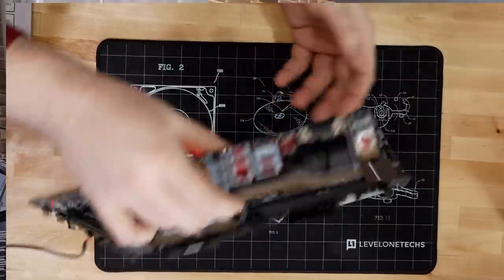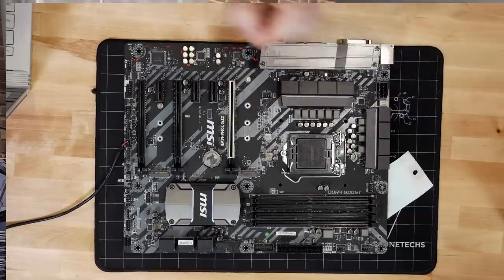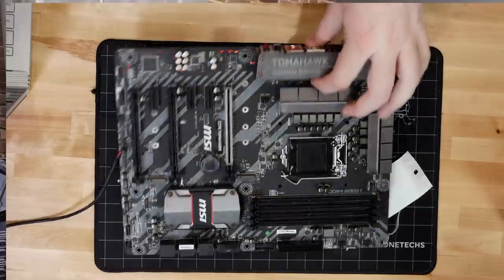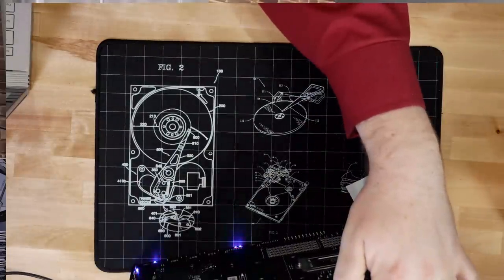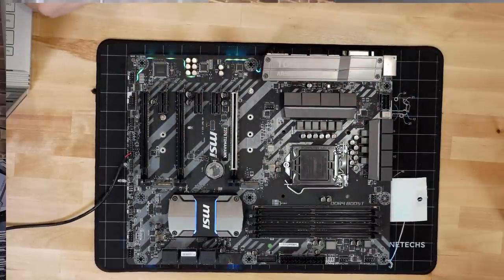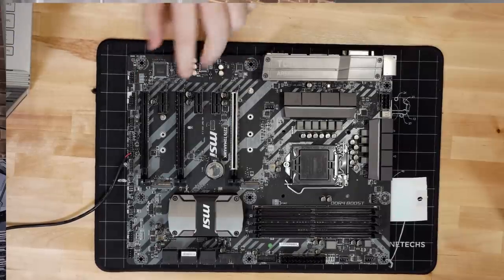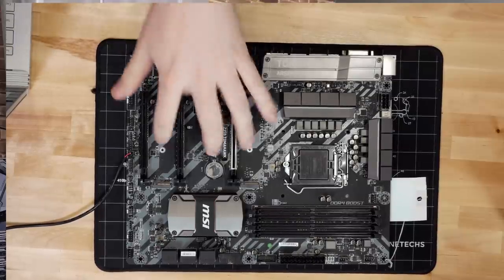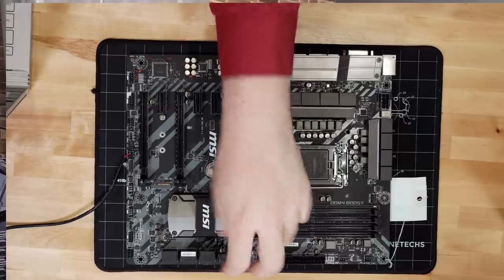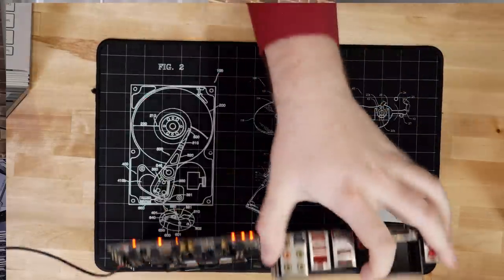So this is Crossfire. It's 16 PCI Express lanes into the CPU, and then two sets of by four. So it's Crossfire only. No SLI, because of the PCI Express routing. So, yeah, RGB 7.1. This is the upgraded Realtek audio codec. 2x4 slots, 3x1, 2 M.2, 6 SATA, 6 gigabit per second. Then you've got your four USB 3.1 Gen 1 front panel connections. And also you get the USB Type-C at the back.